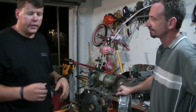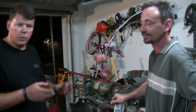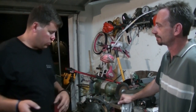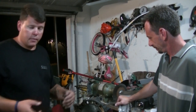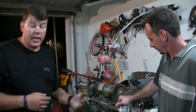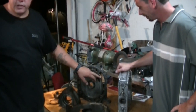It's rough on the clutch foot. It can be rough on the clutch itself. There's a lot of variables that go into it. Most of us guys running around in the streetable rotaries and our everyday driver rotaries tend to stick with something below the bridge port, whether it be a heavy or mild street port. Again, the street port is simply just peeling material off.